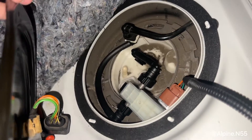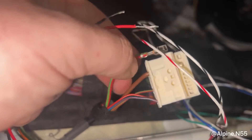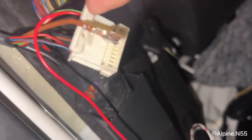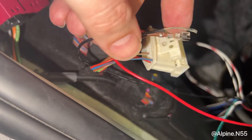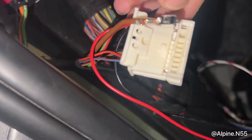Now that we've verified there's no leaks from our fuel lines, we need to go ahead and hook up the Z-Tronics module. What I've done is stripped down the positive and stripped down the negative. Instead of splicing directly in, we're going to pull out each of the connectors, wrap the wire around, then push the connector back in for a solid connection. The stock EKP connector comes apart with this little tab right here. Once you take that out, you're able to press down the pin on each of the connectors, and then the wire will pull right out of the bottom. Once you have that wire pulled out, you want to take one of the wires from the Z-Tronics module — we're going to be doing our ground first — wrap the wire around the base area, and then push that wire back in to your EKP connector. Once you've done all four, go ahead and lock it up.